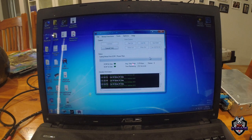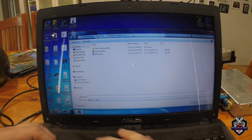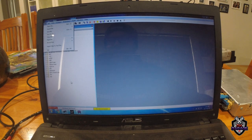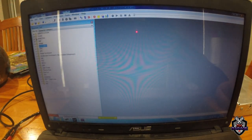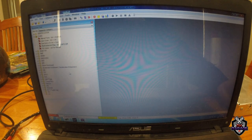Now it is reading out the tune from the ECU — sucking out the factory bin. Then you open up TunerPro, go File > Open Bin, and that's where it will be. Here you have all the parameters. To turn VATS off, I believe it's under Flags — Theft Deterrent. If you click it to 'set' that means it's turned off. Happy days.